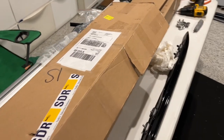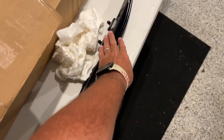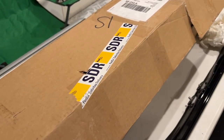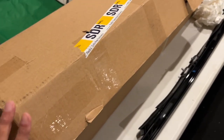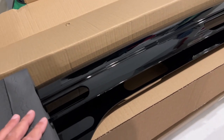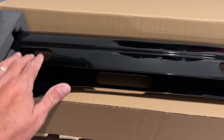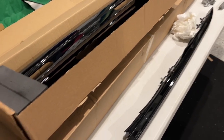Since the parts for the back — the rear ditch finishers — that take this slot here and this slot here, since those were the wrong parts, they're now just laying in the floor because I can't return them after peeling off the adhesive strip. Keep that in mind — check and make sure everything fits before you go ahead with installation. The new ones from Land Rover Columbia, South Carolina were overnighted and showed up by FedEx this morning. They do have the correct two cutouts in each one, so we're going to go ahead and put those on and then start attaching the roof rails.